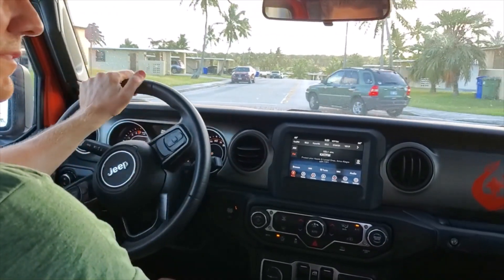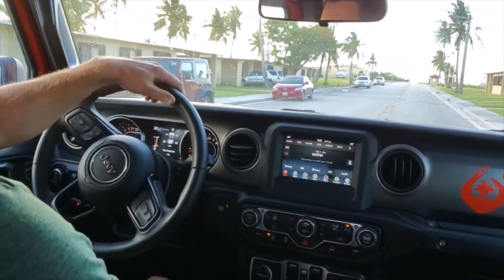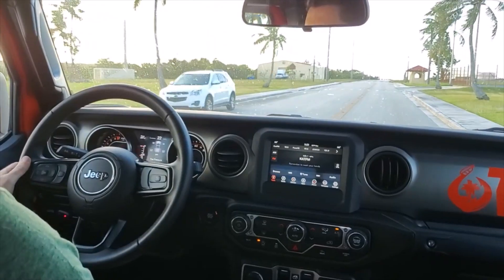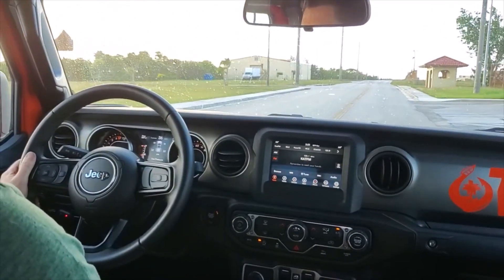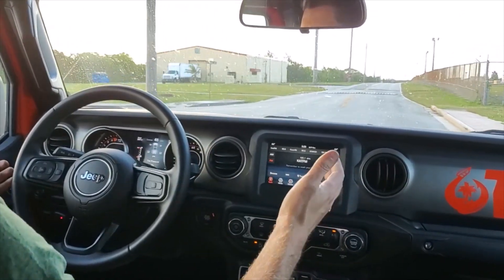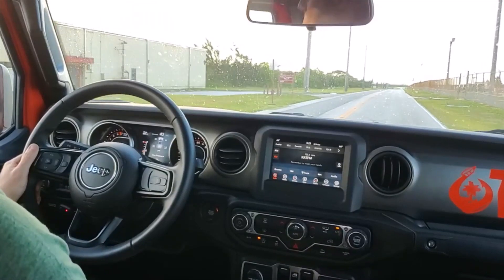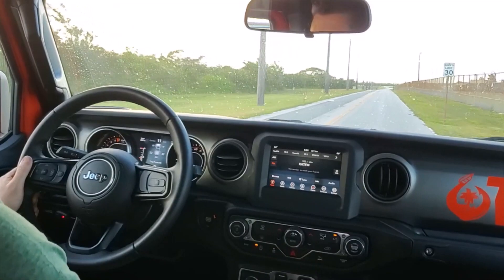Find out if that's part of the problem. We are driving now without a steering stabilizer. I have my suspension dialed in, I have 35-inch tires, I'm running 32 psi, and I straightened my steering wheel with my drag link adjustment using a 15-millimeter socket. Steering's nice and straight, doesn't feel like it's wandering. No weird jerks or anything — it didn't need to soak anything up.